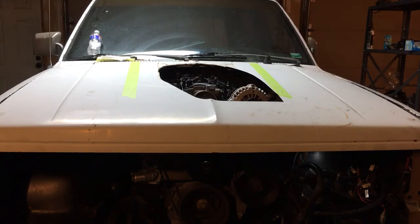So as long as you didn't have a different intake or some offset air cleaner base, you could run - I think - up to a three inch filter on like a single plane Victor Jr. intake and it would just come up through a circle in the hood.